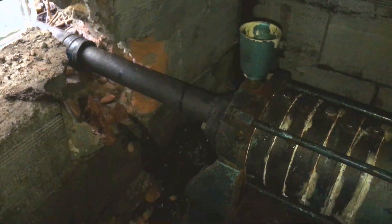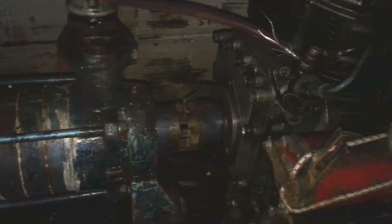The next step was to get the diesel tank in place and get ready to start the engine — but without linking it to the water pump, just to make sure it was running properly and that the vibrations were mitigated with these massive silent blocks. This engine has no decompressor, so it's pretty hard to start manually when it's cold.